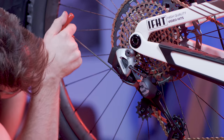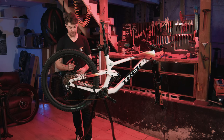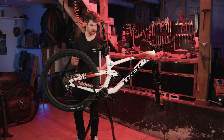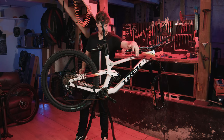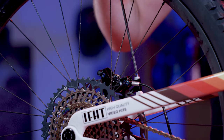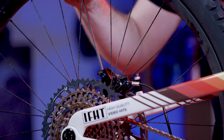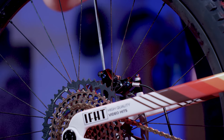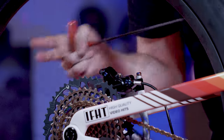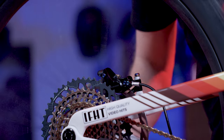We're also going to align the brake caliper. The easiest way to get started is the old classic: you pull the lever while the bolts are kind of loose, see where it sits, and then tighten the caliper gently — not full torque — and see where it gets you. Sometimes this aligns it perfectly on the first try, and yeah, we're actually really close.